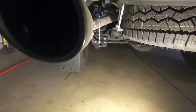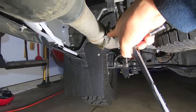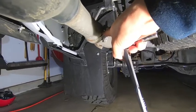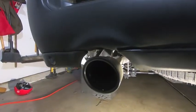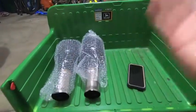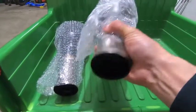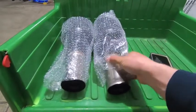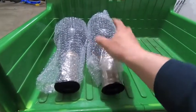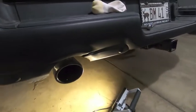To remove your exhaust tips, use a 13-millimeter socket and completely remove the clamp — removing it fully makes it easier to get the tip off the ball and socket joint it's holding onto. Back that off with the 13 millimeter. Also, the resale market on these tips isn't great right now, so I'll just hold onto them as winter tips. When installing the new tips, I'm leaving the bubble wrap on until they're attached — in case it falls, it's protected, and it also protects the finish from the bumper.